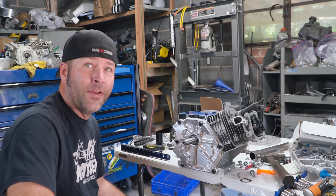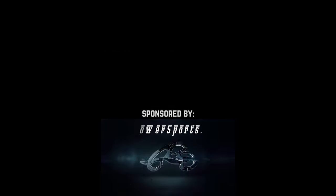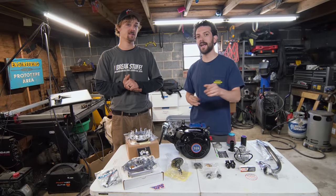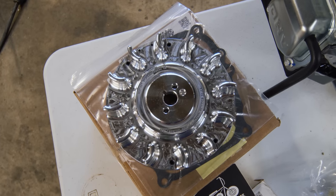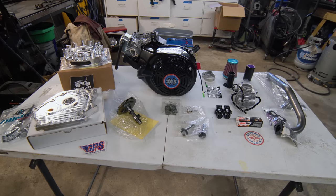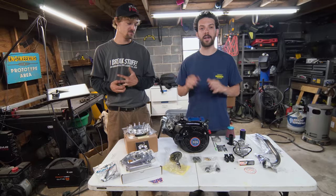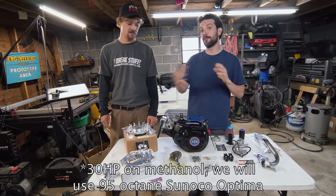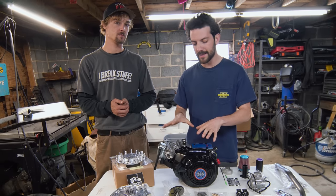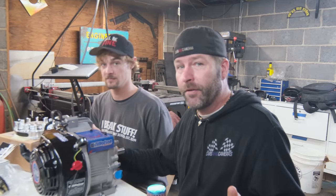On today's episode of Cars and Cameras, we are building a Tillotson 225 engine — but no ordinary Tillotson 225. This is going to have a 285 cam, DIY head porting and polishing, oversized valves, and a 28 millimeter flat slide carburetor. What does all this mean? This motor is going to turn to 9,000 RPM and make 30 horsepower on the Go Power Sports dyno. We're going to be installing it on a full suspension Mega Moto mini bike, maybe even our Tillotson T4 in the future. Go Power Sports sent us everything you see here on the table — there are a lot of moving parts, and if you want to know what we've got, there are links in the description.